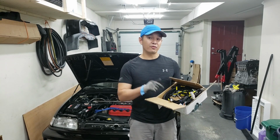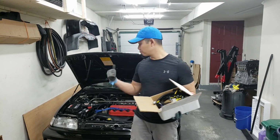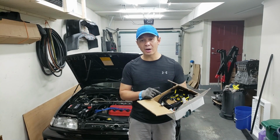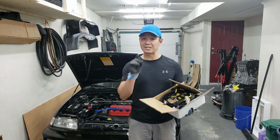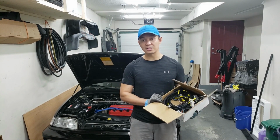There you go, guys. We've confirmed that the China budget harness and my self-made chassis adapter both work perfectly fine in the car. We did see that the alternator was wired incorrectly. I have since fixed that. No more battery light and all that stuff. So all the dash lights are clear, as you can see in the video. Everything is good. This harness works flawlessly.